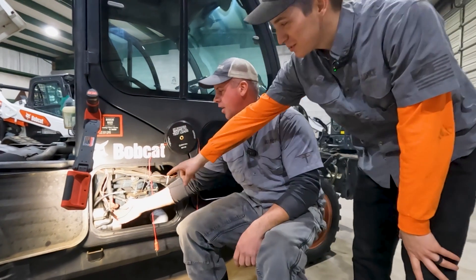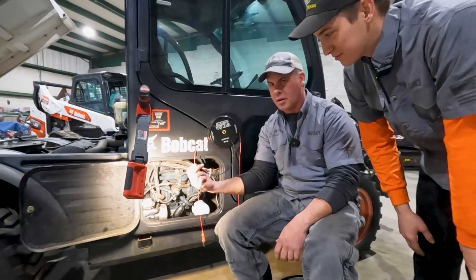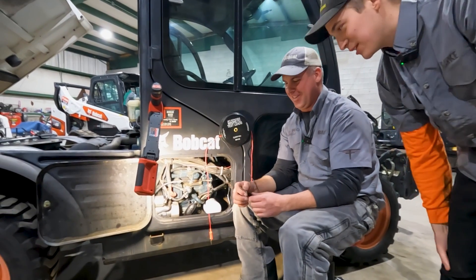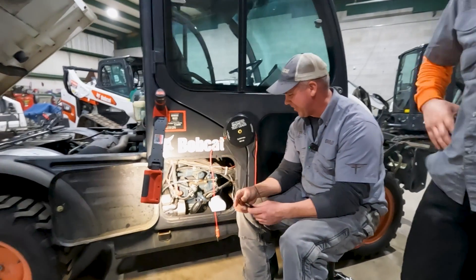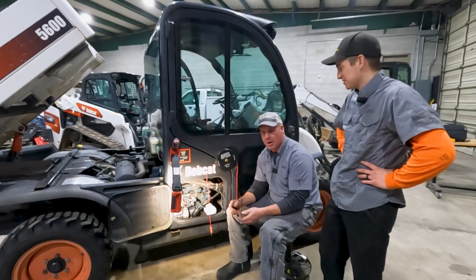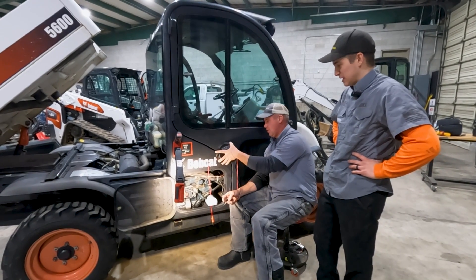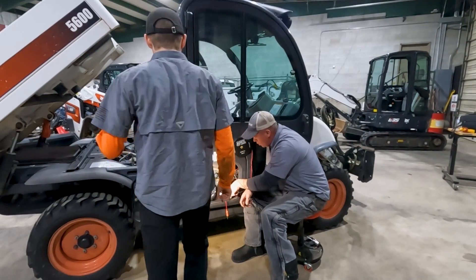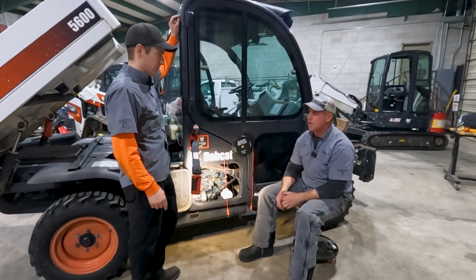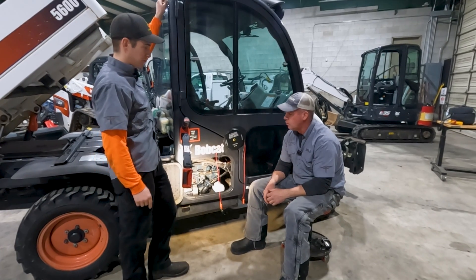I shut it off because we have constant power here and the key's not going to work to shut it down — you have to cut the power directly. So when we bypass the solenoid like that, that tells us the solenoid itself is working, but whatever is supposed to be telling it to hold is not working. It could be the wire in between, or it could be the controller itself.